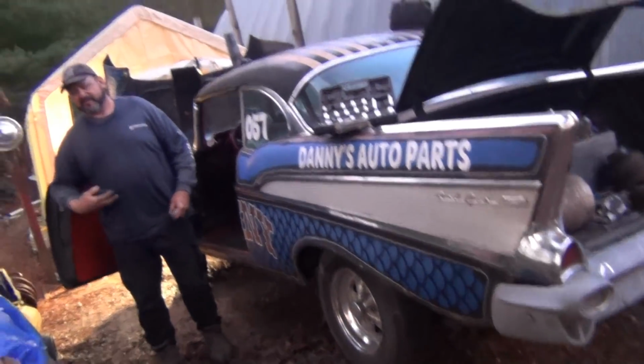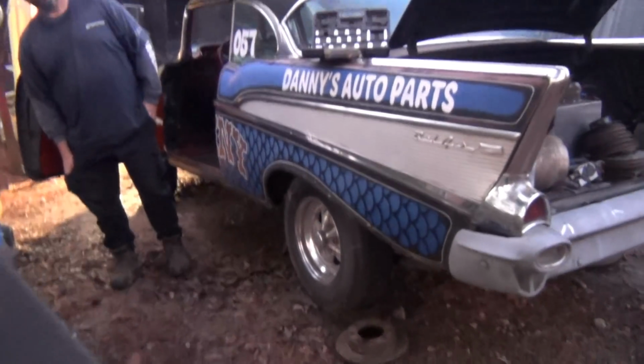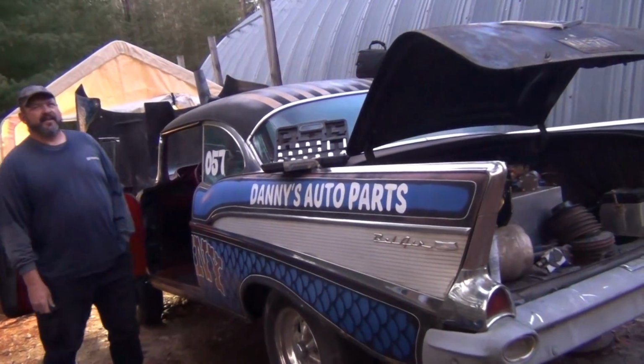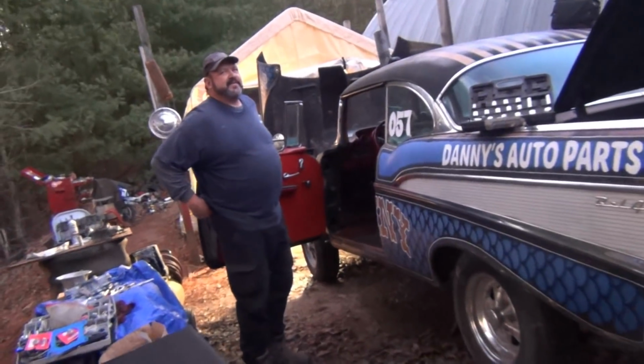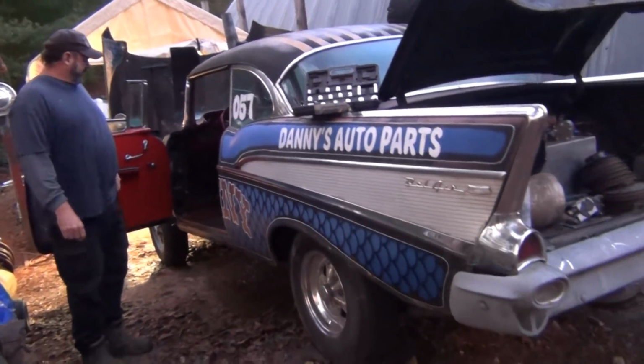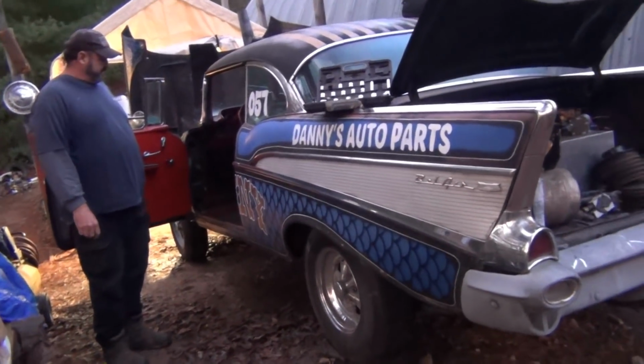That's good. Oh yeah, you can tell that carburetor is a little lean. Like when it goes to rev, it's kind of weak, instead of bam bam. But we'll see what it does. I like bam bam to me instead. Well, standing back here, you can hear a little bit. Like it definitely needs to be stepped up in jets.